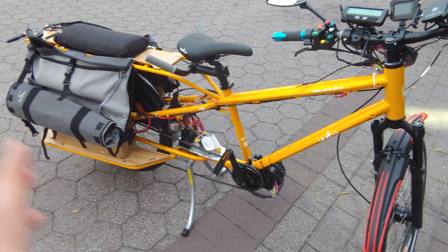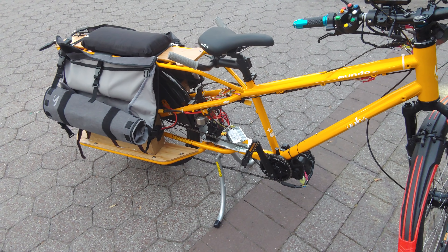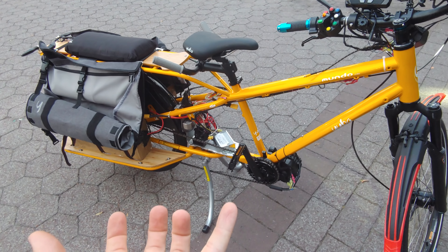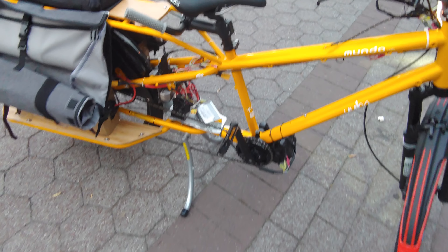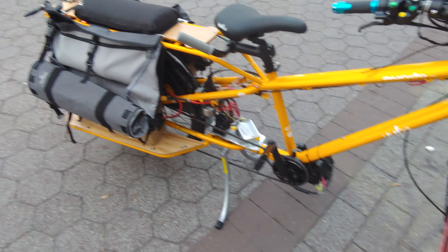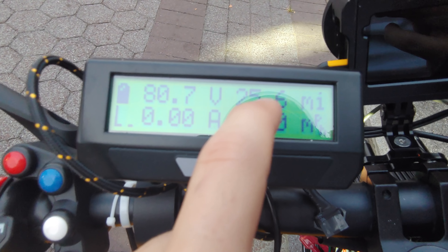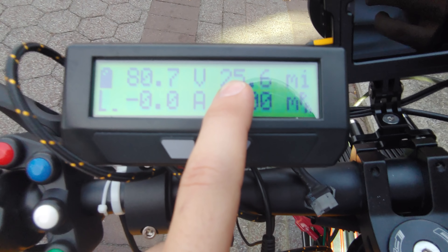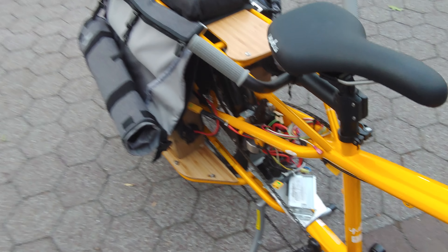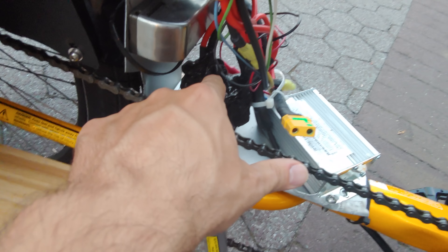So I'm going to have another one over there. Got an XT90 here. I can charge them all at once using this — I actually got one of those J1772 to IEC connectors, so I can take 240-volt 15-amp output, which could get to a power supply that's 84 volts putting out 20 or 30 amps. If I get a 30-amp 84-volt power supply, I can charge all three batteries maybe inside of an hour, hour and a half. Look at the range this thing's getting — 8.7 amp hours got me 25.6 miles. This is already getting better mileage than the other one because I'm using the batteries in parallel. Those are 35E cells inside those, by the way — each one of those batteries is 20 series, 10 parallel. Look at that waterproofing right there. Beautiful.